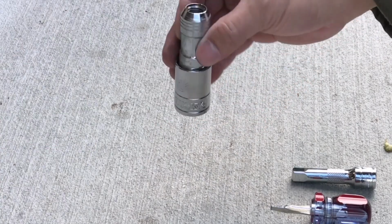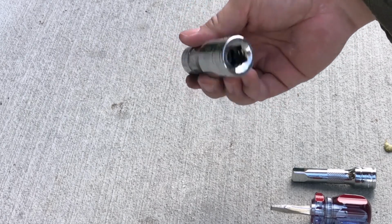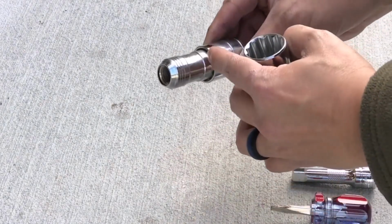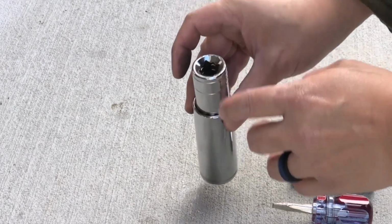After removing the lock nut, you will need to get it out of the socket, so you can reuse the socket for the other wheels. To do this, take a slightly larger socket. Then, drop the used socket with the lock nut stuck in it into the larger one.